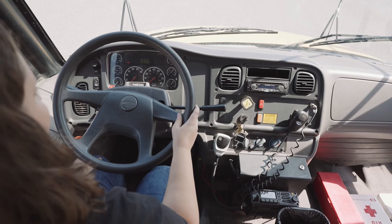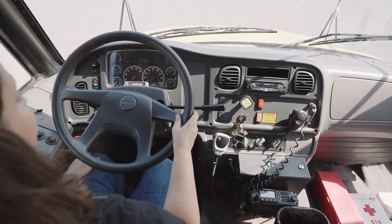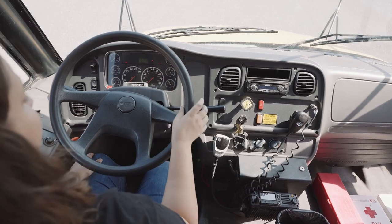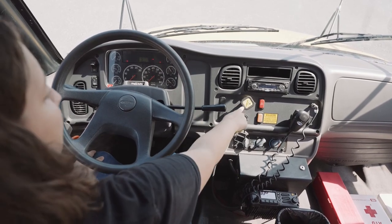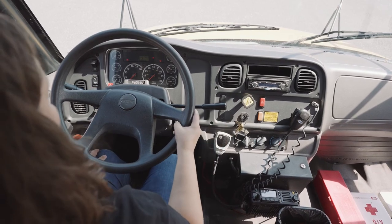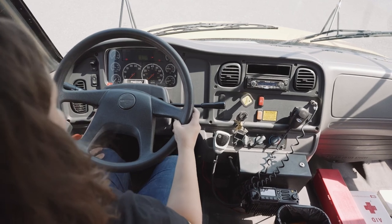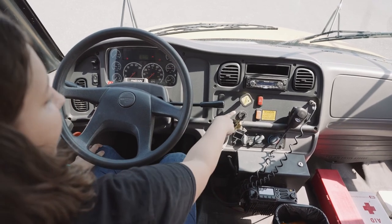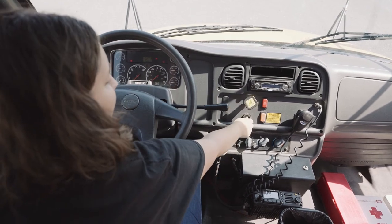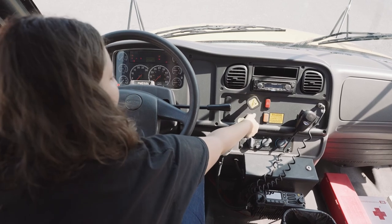In which it did not, I am now going to fan my service brake, and at 60 PSI, the warning light and buzzer will go off. At 20 PSI, my parking brake will pop up. In which it did. Now to build back my air pressure, I'm going to set my bus back into start. It is a safe start since it was in the run position.